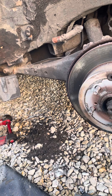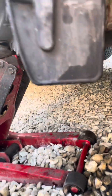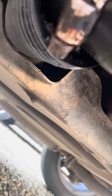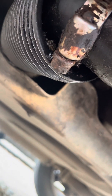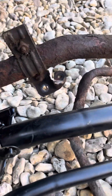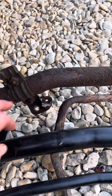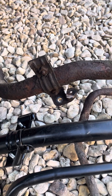Underneath here, where the pipe goes — get under there and you'll see a jubilee clip. That's a 10mm socket you'll need to loosen that. Then you can work the pipe out from the bottom — the bottom of the filler. Once it's out, you'll see how rusty it is. They rust like mad and you end up with pinholes in it, and obviously you'll find you'll be leaking fuel.